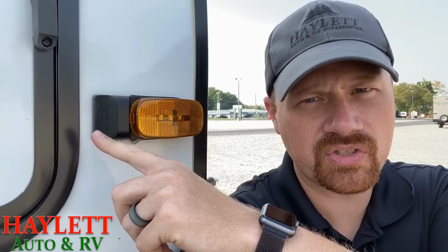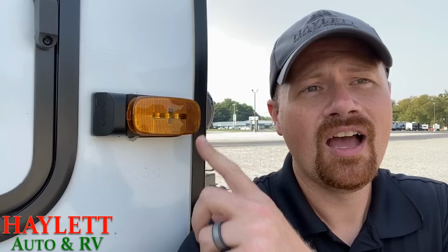Now, to try to proactively address a question, J-Smart lighting will cause this thing to blink. A lot of people are thinking, yeah, but if I install a camera over here, isn't that going to cut the power in and out of the camera? Aren't I going to lose the feed? The answer is no. Thankfully, the people at Jayco, smart people, thought of that. They've got over 50 years of experience. I think Coachmen's the only other brand I've seen around there that can even match that, exceed it slightly. But they said, we need two wires. We need one wire to power the light. We need one wire to power the camera. So the light can blink all at once. It's not going to cause the camera to clip in and out.